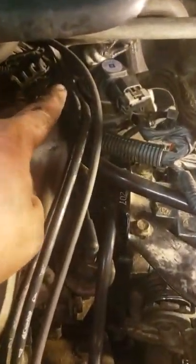It's straight back about six inches down on the valve cover — you'll only see that if you take the mounting brackets off. See that bolt right there and the bolt right there? Those are 10 millimeters, for the mounting bracket for the ignition coil. I didn't take it off all the way; I just pried it back so I could get my hand back there to reinsert this tube, which is very hard PCV plastic that can break very easily. I got lucky it didn't break. The tube comes out really easy when detaching it without you realizing it. So it's straight back — follow the tube straight back, it does a short curve and goes into the back of the crankcase at the valve cover. Move that bracket, lift it up, reach your hand straight back about six inches, feel through the valve cover for the hole, and guide the tube back in.